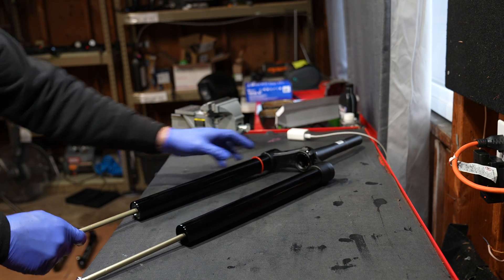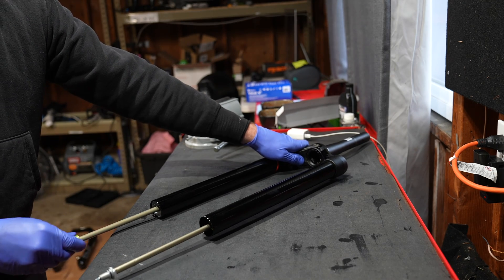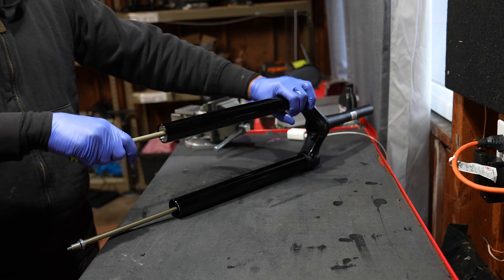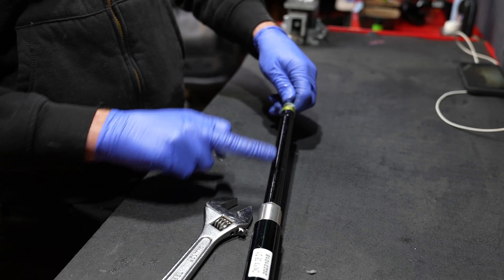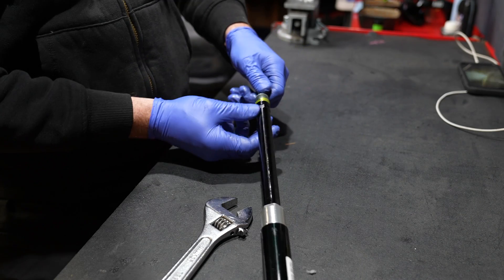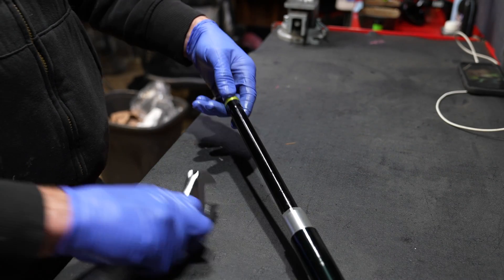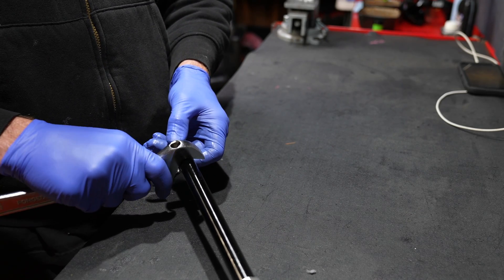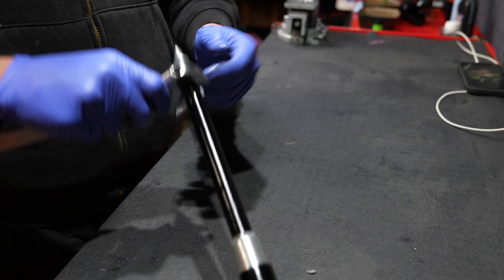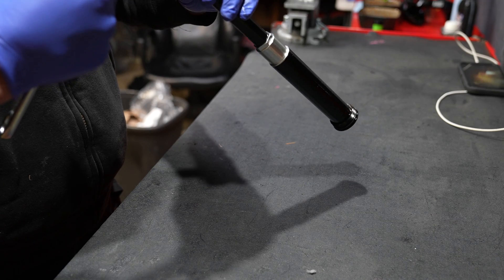Very user friendly. The next step is ripping the damper apart, which is quite a bit more involved even compared to the previous model DVO Onyx dampers. The DVO instructions call for 26mm shaft clamps that are super rare with no generic ones on Amazon, so I'm going to show you how to hack your way through this to change the o-rings and service the damper. The previous model Onyx had the bladder sitting inside the inner stanchion, but now we have a multi-piece tube that's kind of a nightmare to take apart.